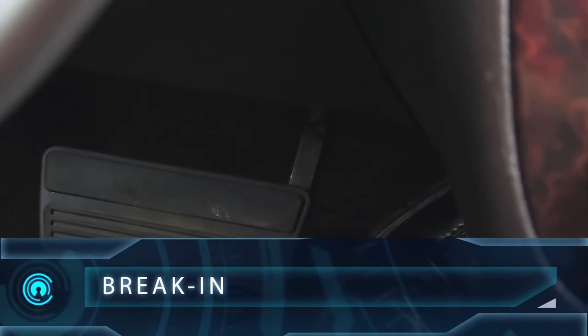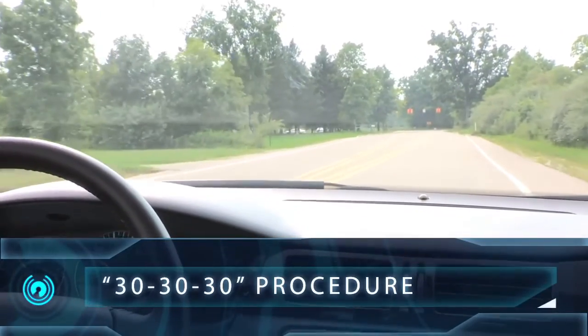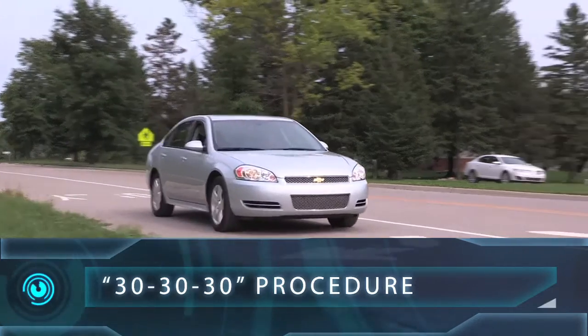Properly prepared, lubricated, and adjusted brakes will give your customers an experience in superior customer service and a safe and quiet ride. Before your customers drive out of your shop, be sure to complete the burnishing procedure, or what is commonly called brake-in. You should first ensure that the brake pedal has good tension by gently stroking the pedal to move the wheel cylinders and caliper pistons back out of the normal position. After confirming a good pedal, you can execute the burnish procedure through a test drive. Our team recommends the 30-30-30 procedure: perform 30 light gradual stops from 30 miles per hour with 30 second cooling intervals between stops.